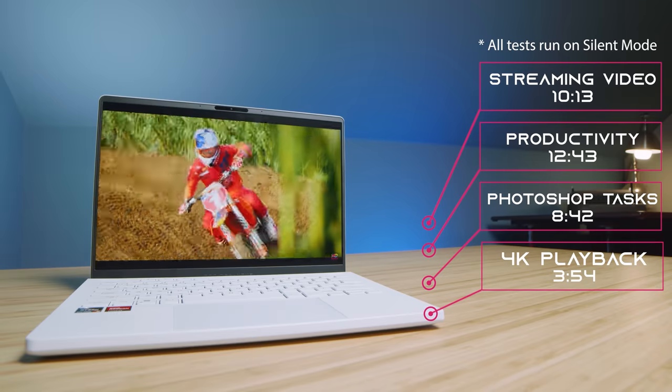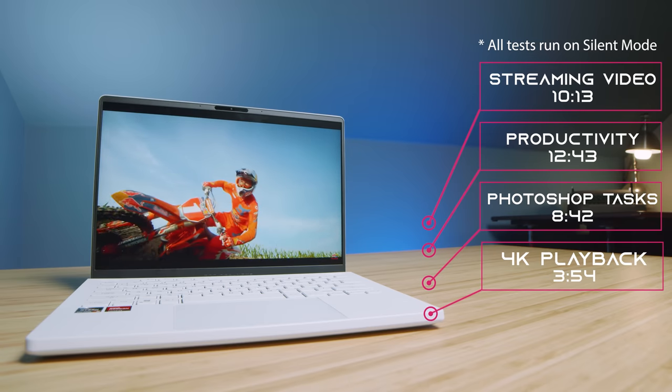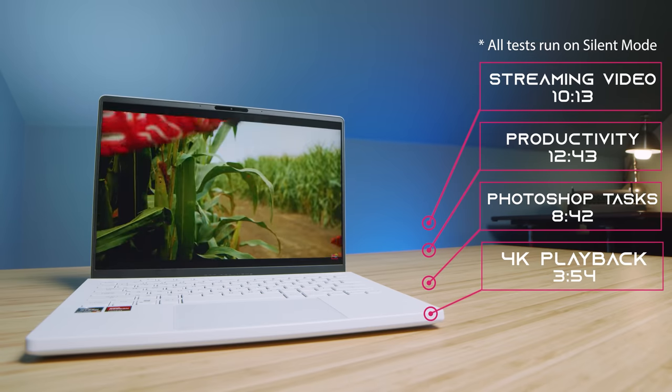One of my favorite parts of this new laptop is the battery life. We have the same 76 watt-hour battery, but because of the optimization between the GPU and CPU and the further optimized Ryzen 9 6900HS, we're seeing improved battery life on the G14. I ran it in multiple modes. For this test I ran everything in silent eco mode with the GPU turned off. I tested Passmark, streaming a YouTube video, the Puget Systems Photoshop benchmark on repeat, and a 4K Premiere Pro project on loop during playback — all at around 35% brightness.